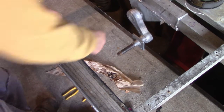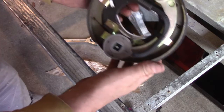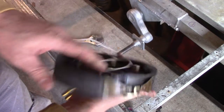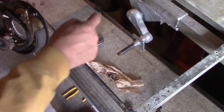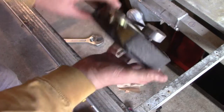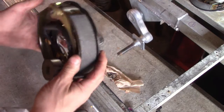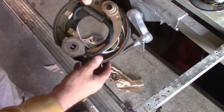So on orientation — left and right — we're on the driver's side. You always want to determine what's left and right. The magnet's always going to be on the bottom, and you always want this arm towards the front of the trailer. So this happens to be a right-hand unit, meaning it goes on the passenger side — you can see how this arm would face forward that way. Then I go to get the other one out of the box and it's the same damn thing — they sent me two right-handers.